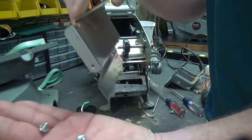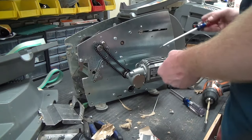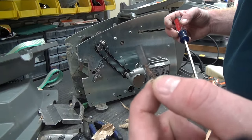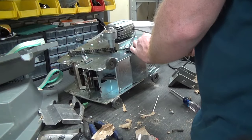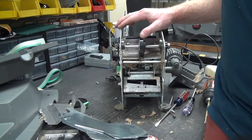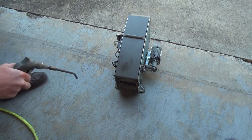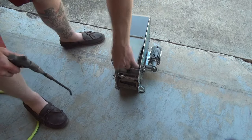I like to take the motor brushes out — be very careful here. I recommend only using a hand flat screwdriver for this, and make sure you're unplugged from power or you will be shocked. Get this motor brush out. When these don't sit in the hole right, when you turn the machine on and press a button, all it'll do is hum, click, and just sit there — that means one is out of place. You've got one on top and one on the bottom. These are good-size motor brushes; I don't think we'll replace these. Now that the machine's torn down, we'll blow it out with compressed air. I'll blow off the circuit board side and then blow out the motor — you'll see a plume of black smoke come out. I like to blow out the back in here too.